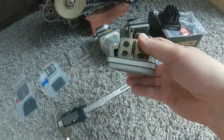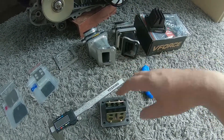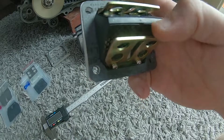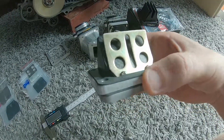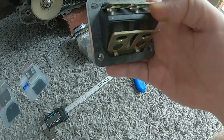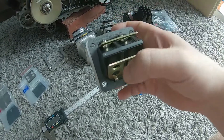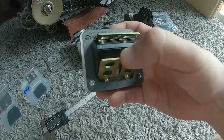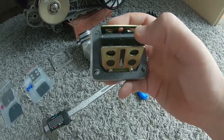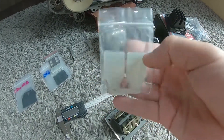This is a stock reed block for the big black TWH manifold, which I have replaced with carbon fiber reeds. As you can see, these are a lot thicker than the original reeds. They're carbon fiber, so a bit more durable, and they spring back a lot better than the standard ones, which I guess are maybe fiberglass reeds. We'll measure up the carbon fiber reeds versus the standard reeds and do a little comparison.